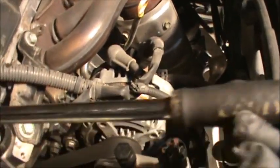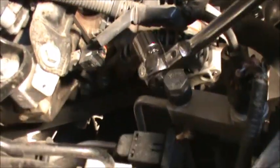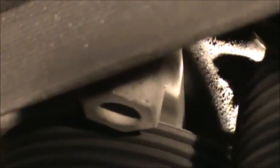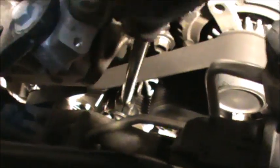I've got my Carlisle ratchet — I like the Carlisle. It's got a swivel head so you can swivel around these lines. It's a 19mm. We want to get right on that socket there, and we're going to go clockwise. A ratchet works good for this, and I like the swivel head because I can maneuver around here. This is a 100-tooth so I can make fine movements.